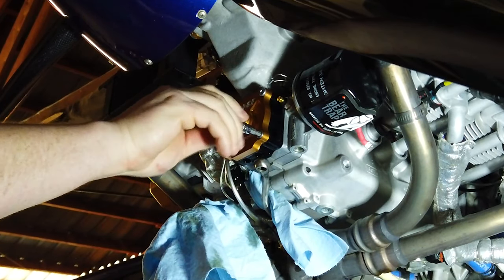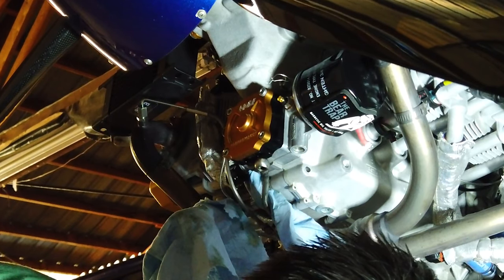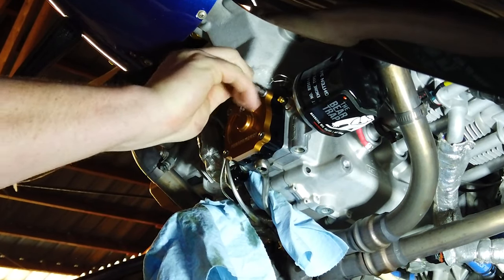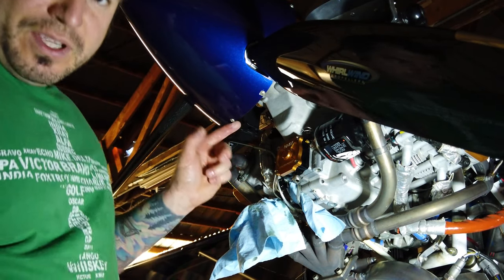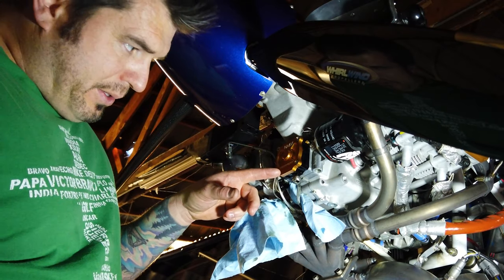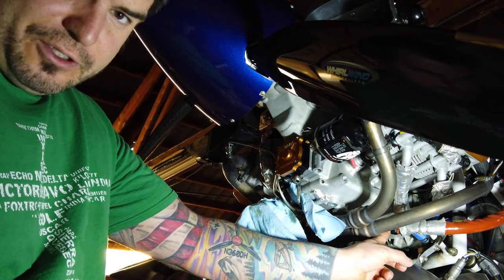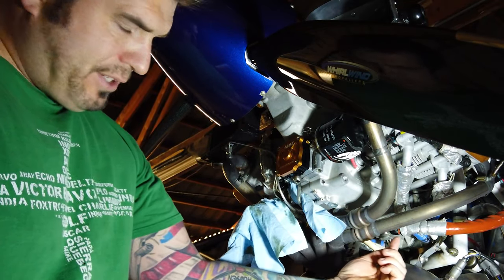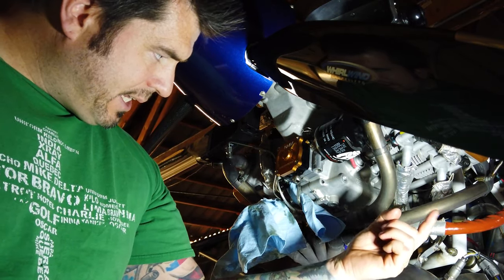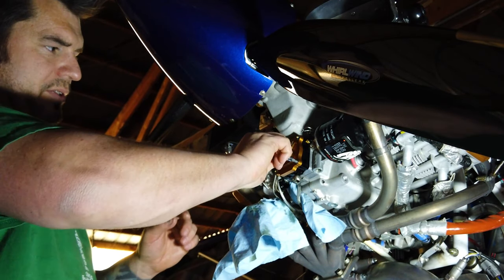Bringing the bolts up by hand to compress those o-rings a little bit — just looking at everything. It's starting to pull up flush. I'll work them all in there. Of course I'm going to turn the motor over by hand, but not until I re-prime the system — that's probably the most annoying part. To re-prime: unhook the return line from the bottom of the engine, cap it off on the tank side, leave it open on the engine side so you can see when oil's coming out, then hook into the breather on the oil tank, put a little pressure on it, pressurize the system, and rotate it by hand. That's the standard deal for priming the oil system on one of these engines.